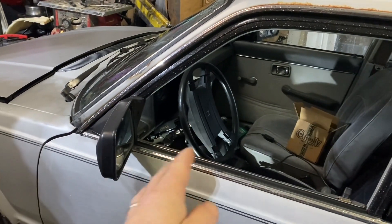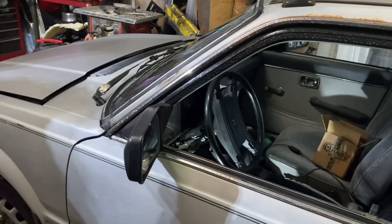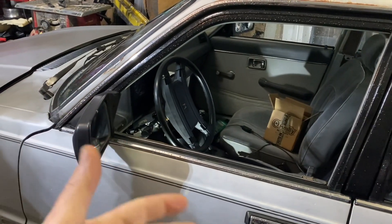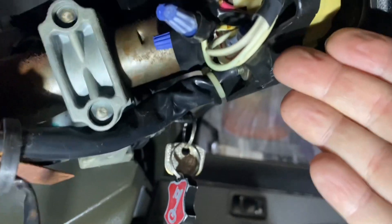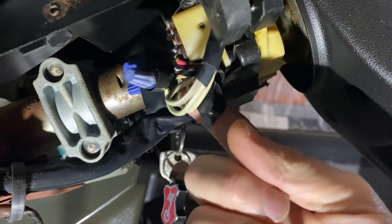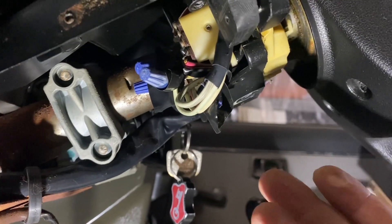You could be running low voltage off the ignition out to a relay and just running high amperage from the battery to the relay to the headlights. There's no reason to route it farther — it draws more amperage to run longer lines, and with more connections you've got more resistance and more amperage. Somebody apparently thought it was a great idea to get into this headlight switch — I don't know if it was replaced or rewired or what — but there are at least four, possibly five junctions here that are just wire nuts and electrical tape. You should never use wire nuts in a car.